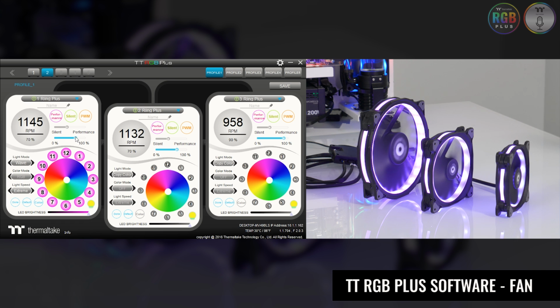I also have the ability to change the speed and function of the fan, where I can enable or disable PWM function, or be able to go into a performance or silent mode preset configuration, or be able to set the value myself independently. Now this is great, being able to set certain fans in my case to certain performance levels as far as where they're needed.